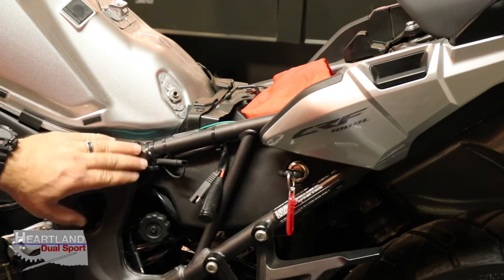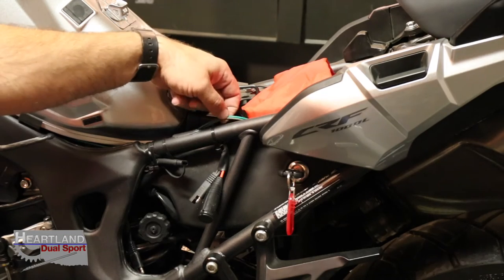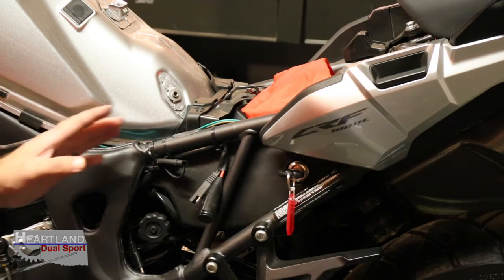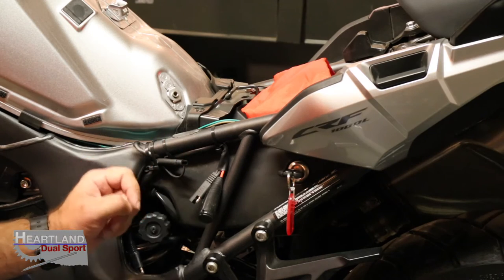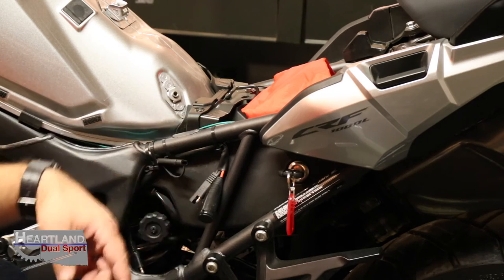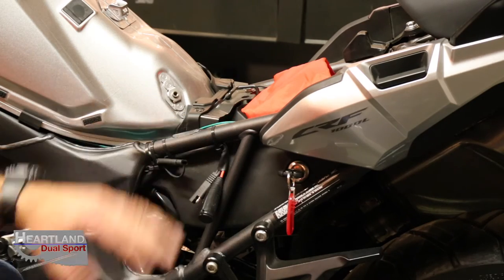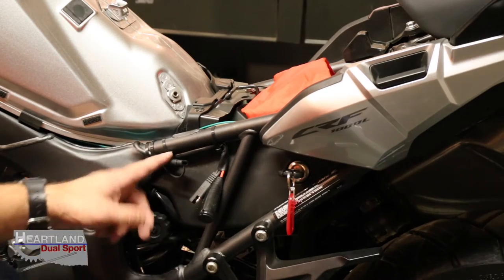I mean, even here's the original wire that I have for my trickle charger. And if you guys can see this, this is an extra wire right here. While you're doing this and running this snake through and pulling your wires to put your charger, if you plan on putting fog lights or something like that on your bike down the road, that's a good time to go ahead and run the wire for your fog lights, and that's what we've done. We're going to end up putting fog lights on the front of our bike later, but I went ahead and put the wires in now, so they'll be real easy.